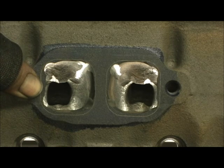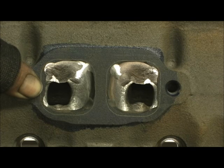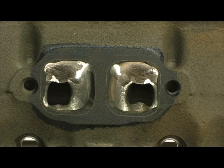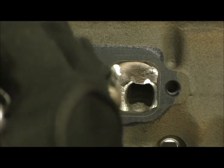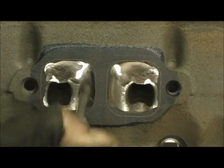Look at that chunk of material that has to come out. Now I'm ready to switch burrs, go in there, and pull the shape out to the corners I had cut — this will dramatically increase CFM. There's this trick, and then the rounding and bullet-nosing of the guide that's going to make all the difference on exhaust CFM airflow. I usually go up in there about three inches as I try to pull it in — just lay in that trench and keep digging — and now I'm ready to switch burrs.